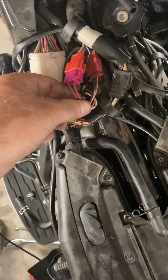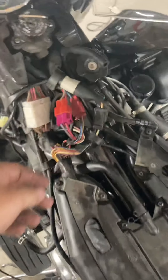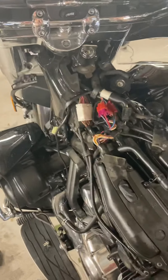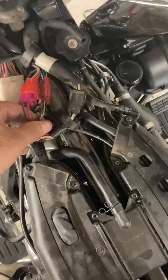Since most of the power is sent through the ignition switch, there's a common chance the ignition switch will fail. So there's a discussion about a mod that you can do by installing a relay, and you'll have to remove your gas tank to do it.